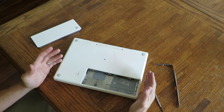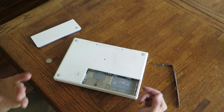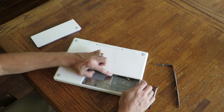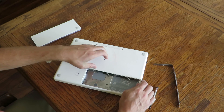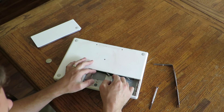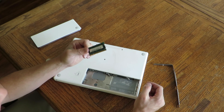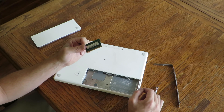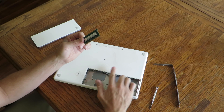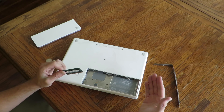In the case of this laptop, what was wrong with it was one of the two memory sticks was bad. Memory is very easy to remove on these. With these little levers right here, all you do is pull the lever and it releases the memory, and you can wiggle that guy out. So there's your memory stick. Once you take one of them out — most of the time every one of these MacBooks had two memory sticks in it — button the whole thing back up and fire it back up. See if it starts.